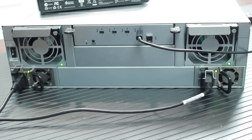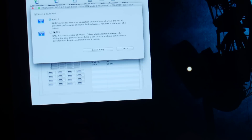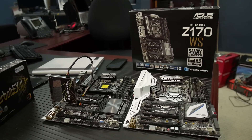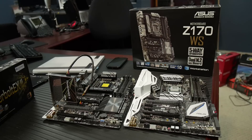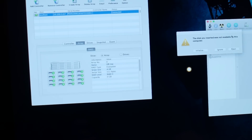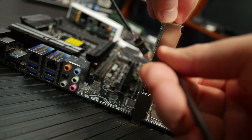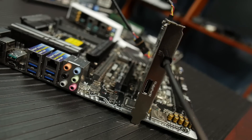I was really skeptical at first, but once I got a close look at it, this thing has four 20-gigabit ports. It is compatible with Linux. It works best with Macs because Macs have built-in Thunderbolt. We've been testing it with the Asus Thunderbolt 2 interface, so that is an option. Linux clients are also an option — you could have a Linux box as a front-end with a Thunderbolt interface, providing connectivity for 1 or 10 gigabit Ethernet clients.